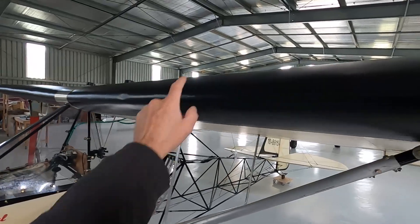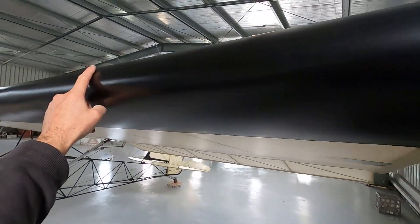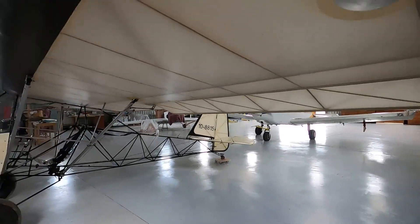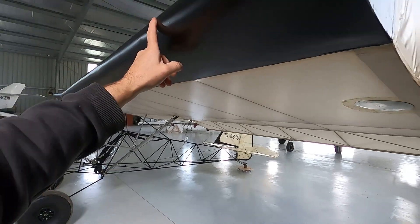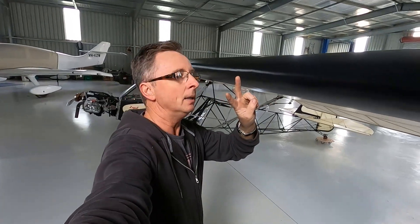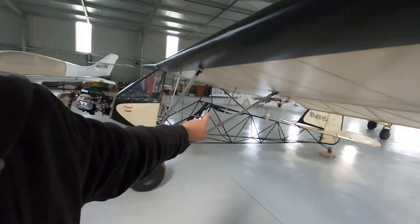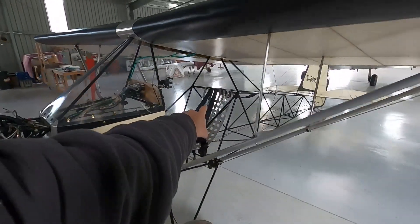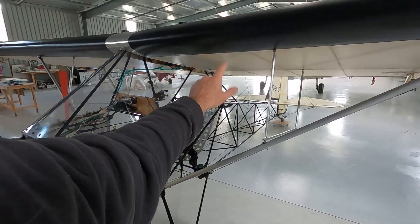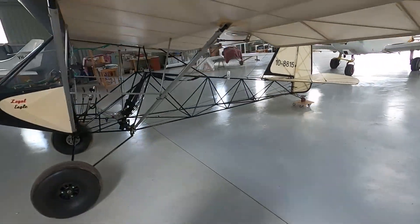Paint on the leading edge of the wing and down the back on the tail all adds weight. It's a couple of coats, quite thick — I reckon two pounds saved there, maybe three or four pounds saved on the fuselage. It's a two-pack epoxy, professionally done. You could save three or four pounds just by spraying it with a spray can instead.